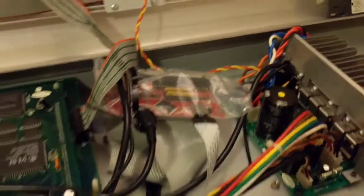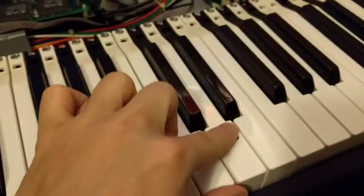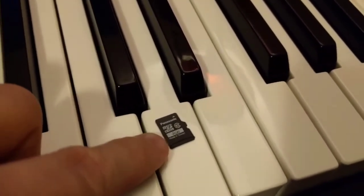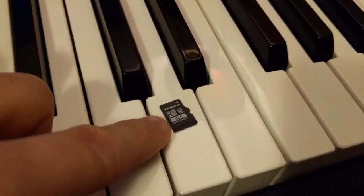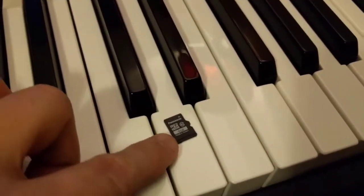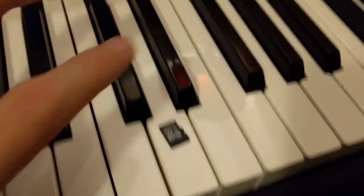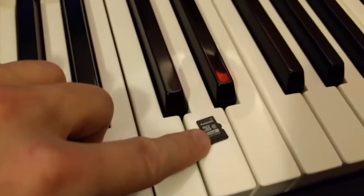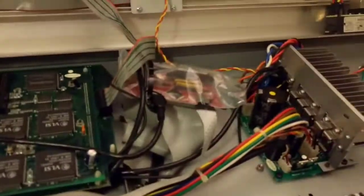I'm going to semi-close it up — meaning I'm just going to close the cover. I've got an adapter for this: my 4GB card, and an adapter that will turn that into SD. I'm going to plug that into the SD reader. It should already be formatted — I think it's FAT16, because FAT32 would allow you to have partitions larger than 2GB, and the Kurzweil currently doesn't support that. So I'm going to put the card in the adapter, put the adapter in there, close this up, and see if it works.